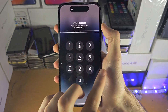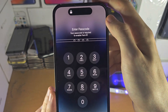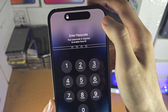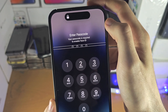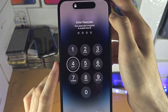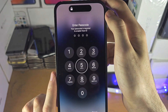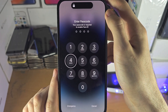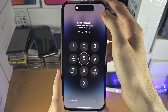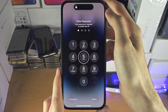Let's say this area of the touchscreen just isn't working, so you can't enter your passcode. What I was saying earlier — watch this. Let's say this area of the touchscreen is working. Just do a swipe, and by swiping to the right I can now select areas of iOS even though the touchscreen in the broken area isn't responding. So you would swipe across, and it will also say the number out loud. If the touchscreen screen is unreadable, when it says 5, for example, and that's part of your passcode, once it's selected just double tap — and you can see it's been selected.